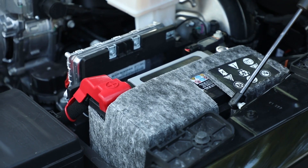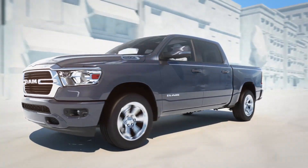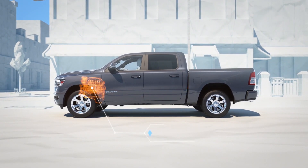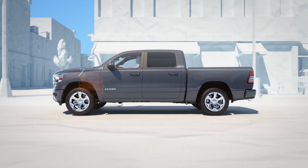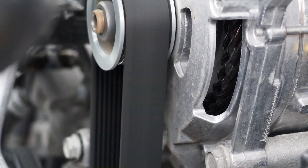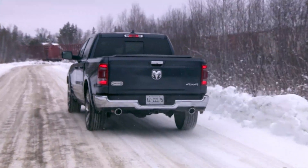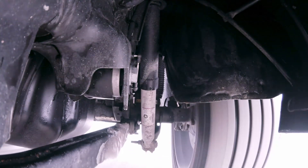If you're wondering, that suitcase battery can be used to recharge the conventional battery even if the motor generator unit isn't currently generating electricity. And then when needed, the juice in that suitcase battery can be sent back to the motor generator unit when you press the throttle. Remember, if you're pressing the throttle, power is not being generated but it is being applied — the motor generator unit is now working as a motor, applying up to an additional 130 pounds of electric torque right to the engine's crankshaft immediately.